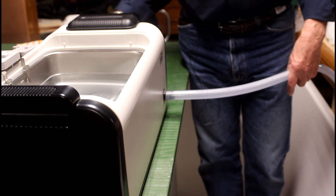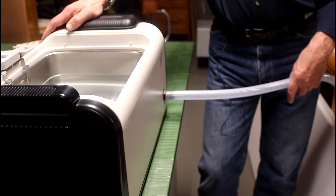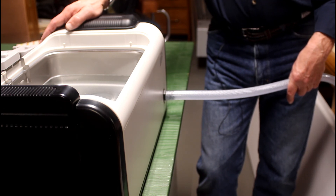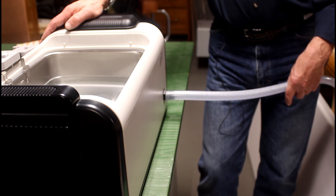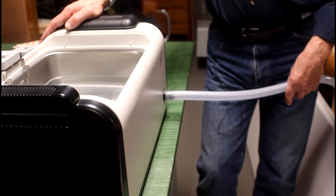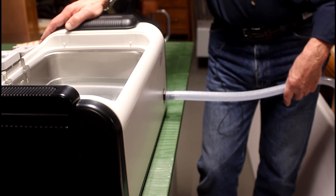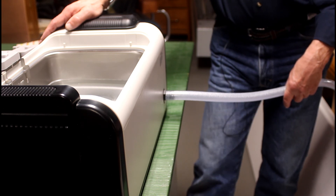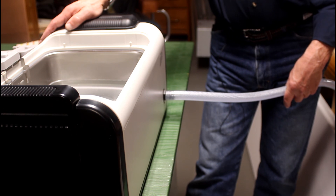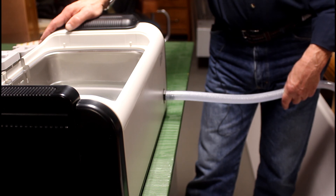I did also experience a couple records that I dried with microfiber cloths. Some of them I air dried. The ones with the microfiber cloths look like they had residue in the grooves from the cloths, and I discovered that by doing a little research. I guess microfiber cloths are not as lint-free as we might like to think they are — they're polyester, and I guess they were doing some shedding. What I found coming off in the records was terrible. It was just clogging up on the needle. However, the records that were air dried sound clear and clean — cleaner than I ever recall the records sounding, and absolutely no residue on the needle.